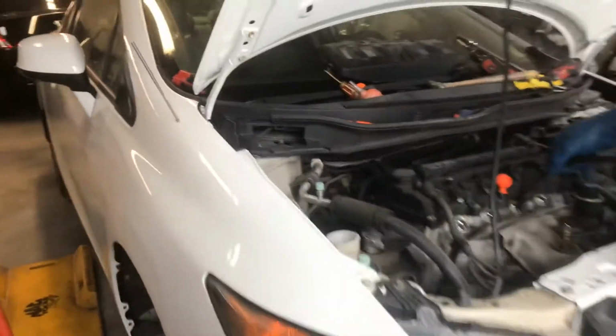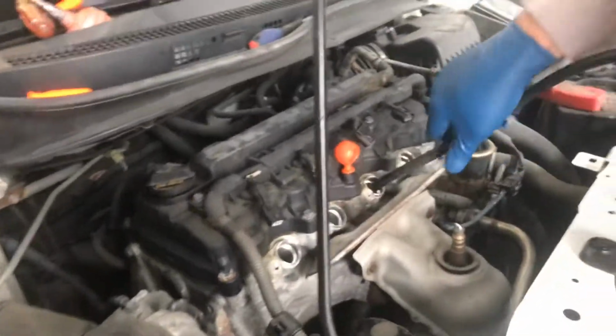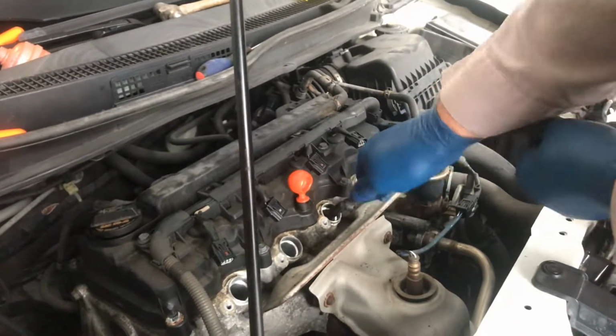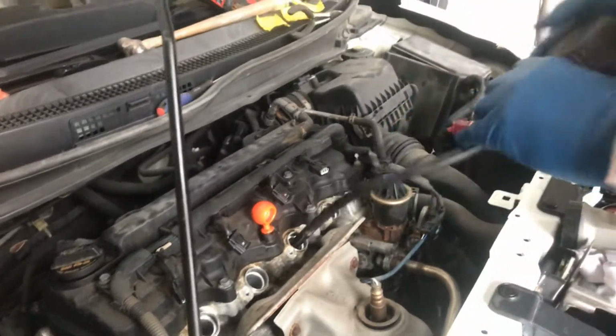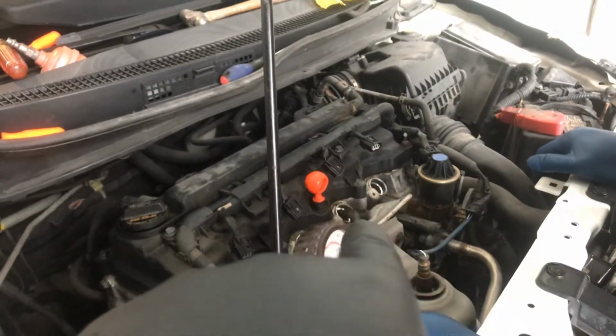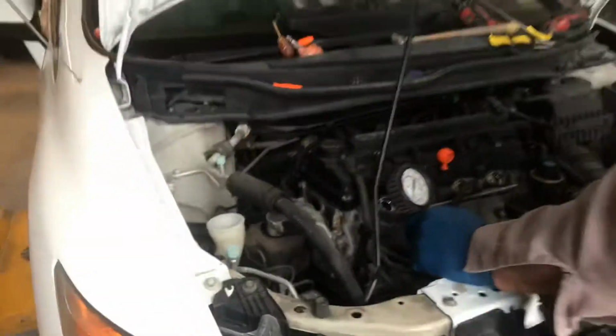But we're on part 2 of this Honda Civic. We just did a compression test and we got 150 pounds in the one that David is putting the compression tester on right now. Then we got 70 there, 70 there, 150 there, and 125-ish on the last one. So we think we have a bad motor, but we're retesting number 3. You ready, David?